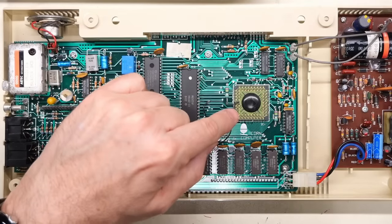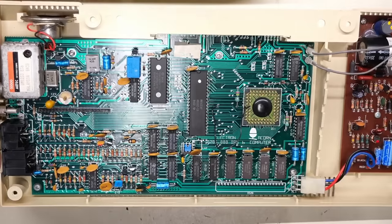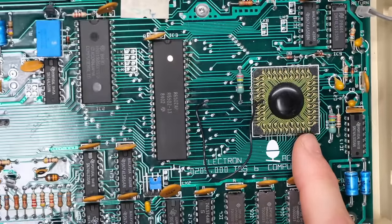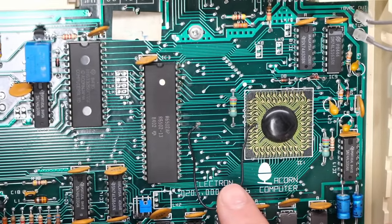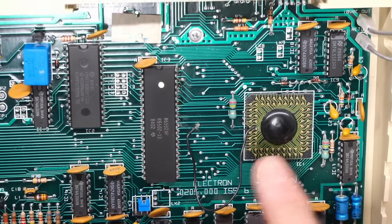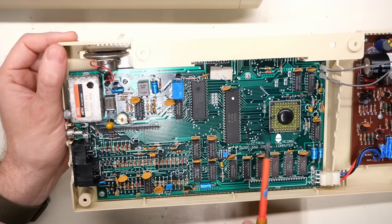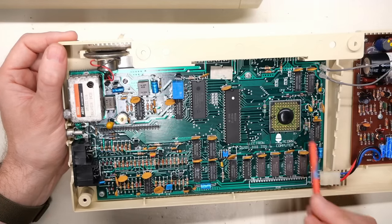This is obviously a later revision — there's an interesting-looking ULA chip there. Underneath a wire it says Issue 6, probably one of the later versions. Earlier issues had a PLCC-type ULA that could come out of its socket. On this version it looks like it's actually soldered onto the board, so if there's a problem with this ULA chip there's not much I can do — I'd have to install a PLCC socket and source another ULA. The computer is very impressive with its low chip count: 32K ROM, a 6502 CPU, the four RAM chips, the ULA, and some TTL chips. The ULA clearly does a lot of the heavy lifting — driving RAM access, cassette port, video output, and RGB.